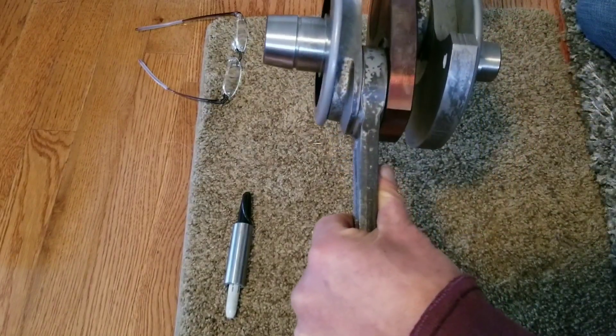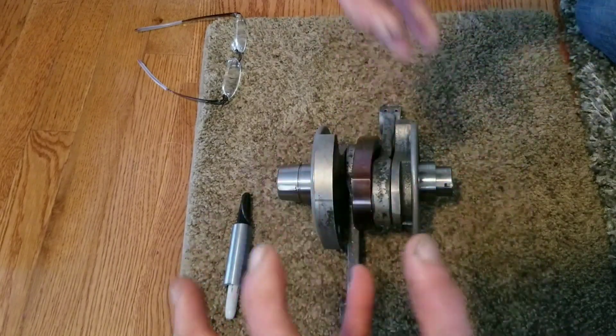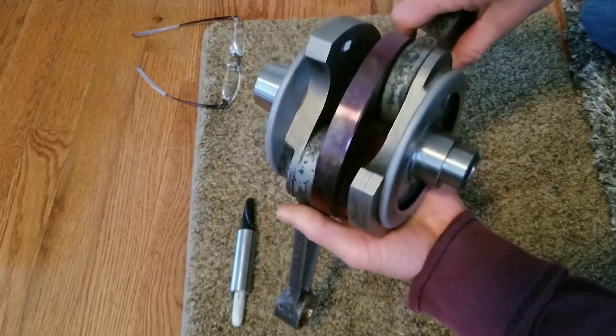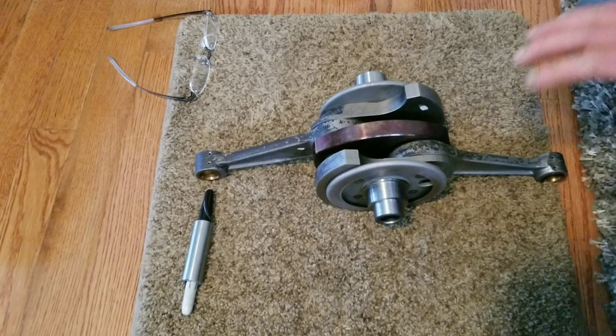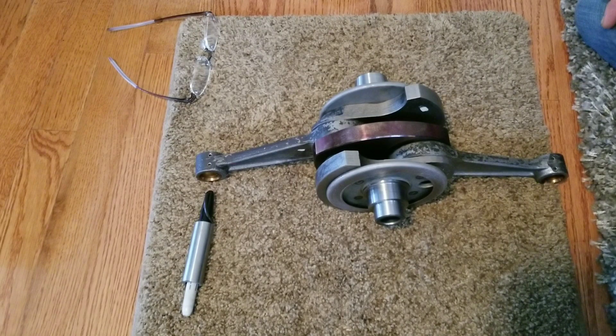Depending on the position, it could force up or down — that is why it's out of timing. Once it's out of timing and it's in the case, it's not going to move; it's just going to lock. That is the nature of the three-piece crank. Even though this crank is pressed on heavy, you can still move it when you have gas in the cylinder. The solution: whether you have a vacuum petcock or manual petcock, you have to kick the bike before you hit the electric start button. If you don't, it's going to cost you at least $1,500 or more.